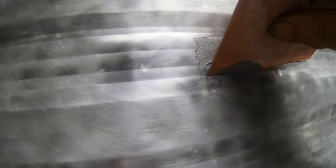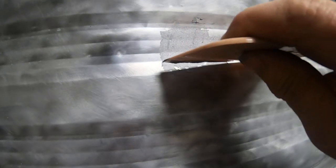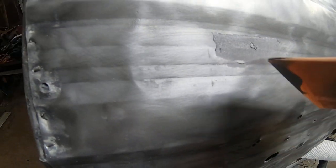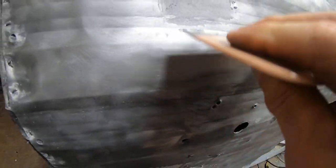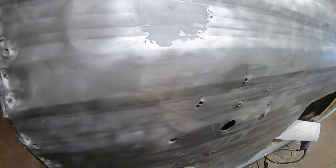You don't want to overdo it. Here's another spot — this particular section has lines in it, so what I want to do is build it up a little higher, then come back and cut those lines in when I do the repair. Here's another little dent right here — again all cleaned up and ready to go. Now you want to wait about an hour then come back.